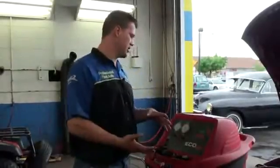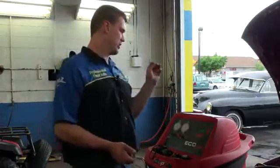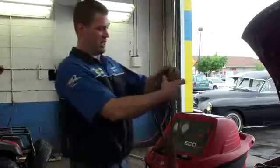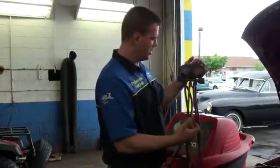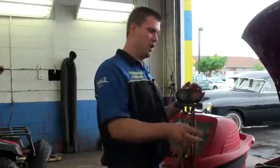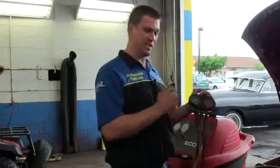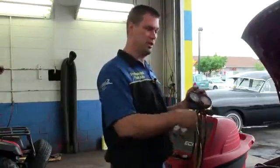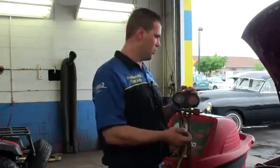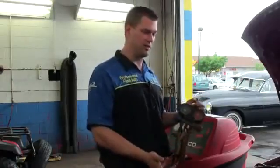Whether you're using a can or a machine to put Freon back in, you select the charge amount and start to fill the vehicle. If using a can, take the yellow hose on the manifold gauges and hook it to the can — your red and blue hoses are already hooked to the vehicle. Figure out how many ounces are in the can versus how many ounces or pounds the vehicle takes, convert that number, and make sure you have the exact right amount. Too much causes major problems; too little causes major problems. Put your Freon in, put your dye in — if you don't have a way to inject dye, you can buy small kits to squeeze at least an ounce of dye in so a shop can easily find a leak later.